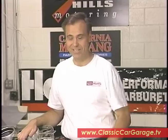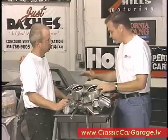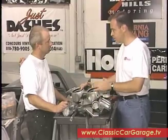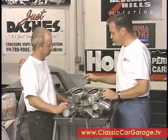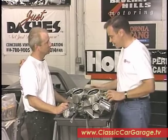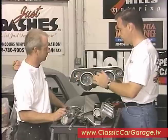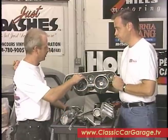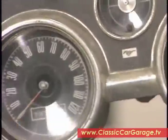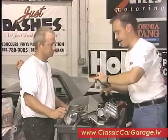Welcome back to Classic Car Garage. Invariably when you're stripping paint, one thing is always going to happen — your nose is going to itch. Best piece of advice I can give you? Don't scratch it. We've got a lot of parts here from our Project Mustang, and these are the sort of things that anyone can clean up if they've got the time. The best time to clean up something like this is when there's cold weather outside or when your car is in the paint shop. This sort of thing really doesn't take a lot of skill — just a little bit of patience, hard work, and elbow grease. Let's start with our instrument bezel. Ours has seen better days — a lot of the chrome-type paint is off and it's very faded. If the chrome wasn't faded, we could just tape it off and paint the black with a satin black or some model paint. But because the chrome is bad, the best thing to do is just replace it. Let's go on to our gas cap — it's a little heavier and it's seen better days too.